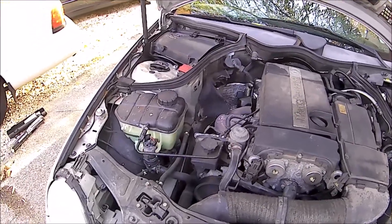We've got this down here holding pressure, screwing it in to keep the pressure in. Unfortunately, I thought this cap would tell me what the pressure should be for the system, but instead it just says 'nicht öffnen wenn heiss,' which I'm guessing means 'do not open when hot' in English. No numbers on the cap or the expansion tank, so I'll pump it up to about 15 psi and see what happens.